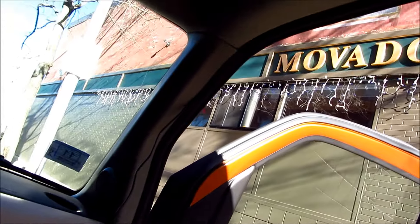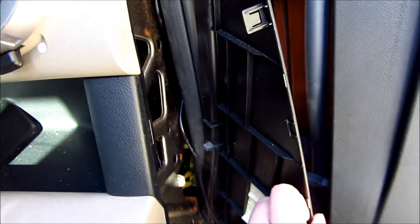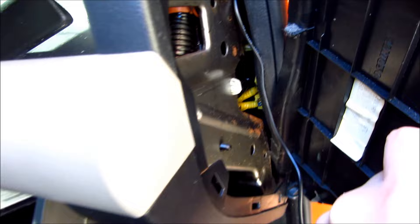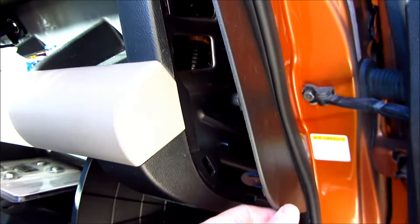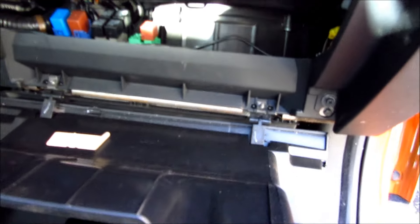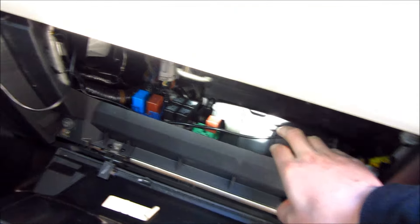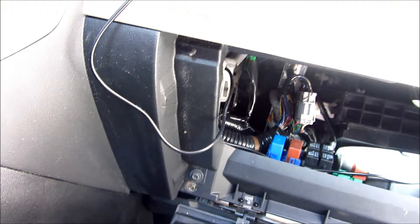Let me pull back and show you. I decided in my case when I popped this out that I could hide it and thread it underneath the glove compartment — just come up and hide it really nicely. This side panel actually snaps out pretty easily, and I've seen this in many cars where you just pry it open, so don't be too afraid to pry that open. In my case I put it around — I took the glove compartment down and put it around and up instead of on the floor.